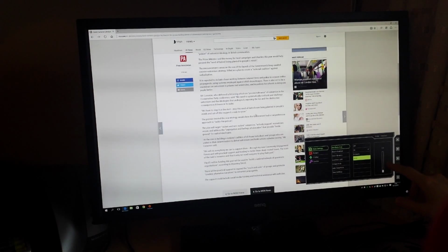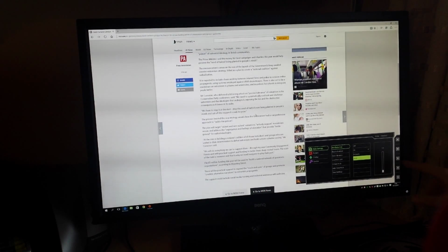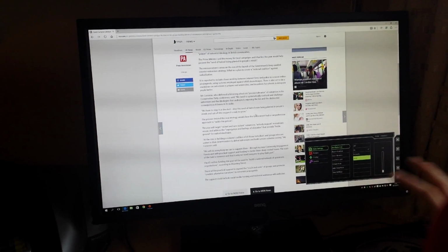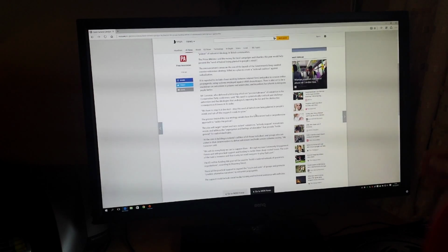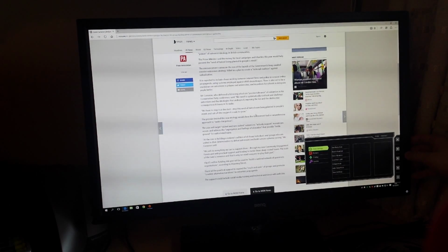You've also got an area setting, because with blur reduction you've also got a problem with crosstalk, which means that sometimes you can get a ghosted image, particularly at the edges of the screen. The area allows you to adjust where the best part of the picture is, and therefore you can choose where the crosstalk is going to occur. It's quite useful. It's nice for the user to be able to pick that.